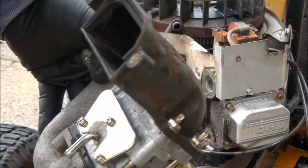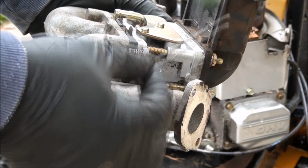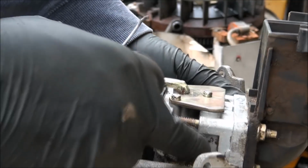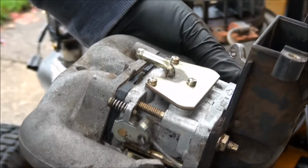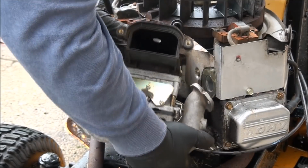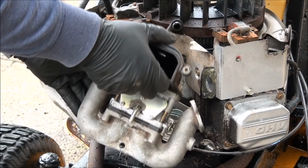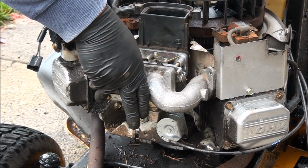So in all the excitement, the linkage came off. And the throttle linkage does go on a certain way. If you see, that's where it mounts. It actually pokes in from the back, so basically you want to have it like this. Like this. Gotta hook up the linkage. That's the important part to hook up first. Hooks right up. Gonna hook up the wiring here. It doesn't matter which way the plug goes. And let's see if we can guide this baby into place. Yep, nice and easy when you have everything installed correctly.